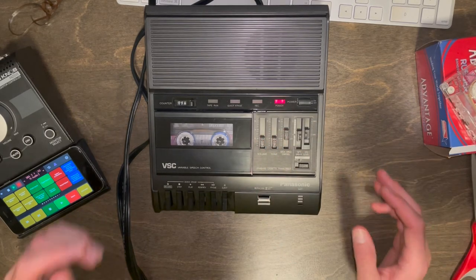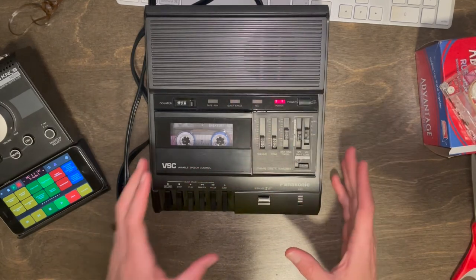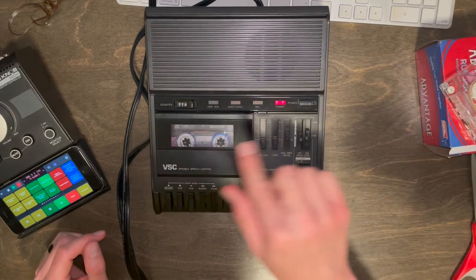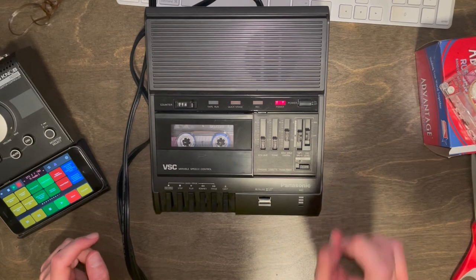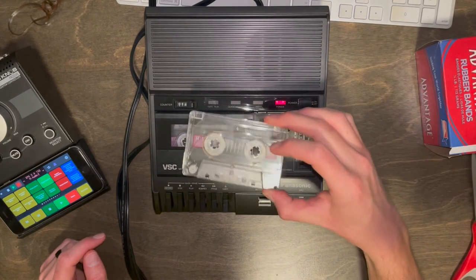So that's how you build the specific cassette to work around the auto stop mechanism of the Panasonic RR-830. Again, you need 9.5 inches of tape in order to make that circle, and you need a size 32 rubber band. Don't stretch it out, otherwise you'll get the warbly movement like this tape we just did.